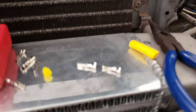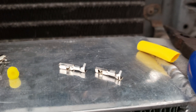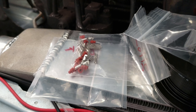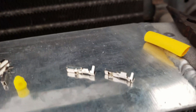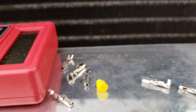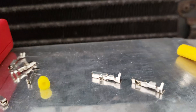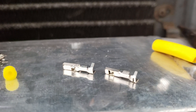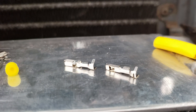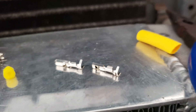Next tip I found out the hard way: pay attention to what pins are going into which connector. They come in little bags - a bag with the weather sealant and the connector - so each one has its own. There's been two kinds that I've been using and I didn't realize it. The extras were building up and I'd grab one, go to put it in, and it wouldn't click into the plug. Come to find out I was mixing different pins. Something to look out for.